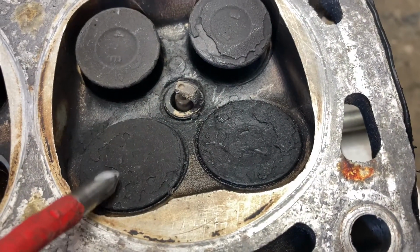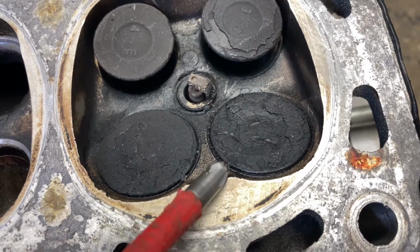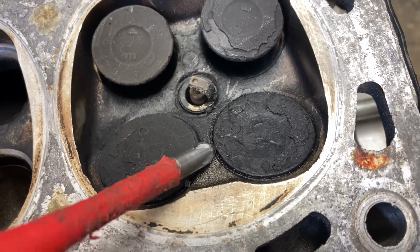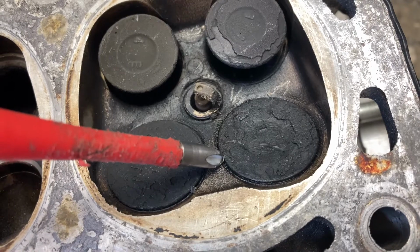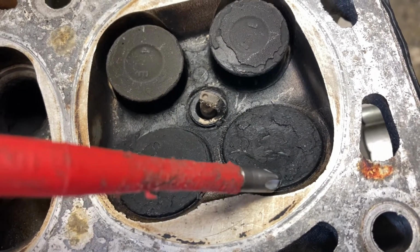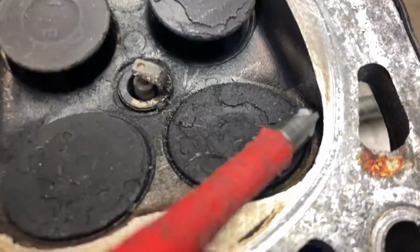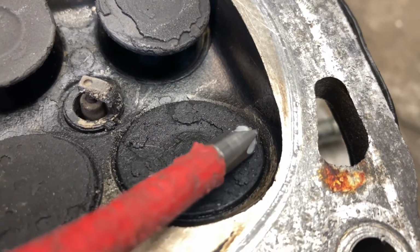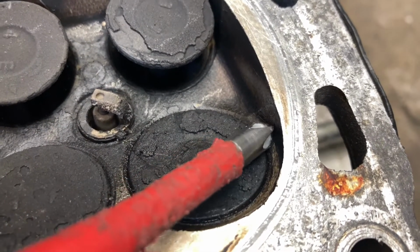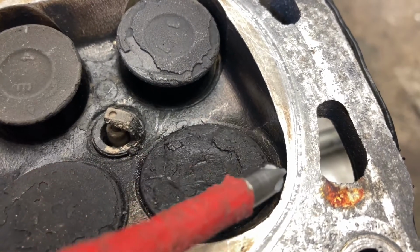Okay, so here is our combustion chamber with our two intake valves down the bottom and two exhaust valves at the top here. As you can see, this intake valve seat is the point of entry at which air will enter this combustion chamber and fill the cylinder. And air is going to have to make its way out of this valve, and it's going to have to come over this casting, this ridge here. And as you go further around here, the restriction becomes greater because this valve gets more heavily recessed. As you can see, air is basically going to have to do a sharp 90 degree turn and effectively fill the cylinder. So that is really the main disadvantage of having these valves recessed into the cylinder head,